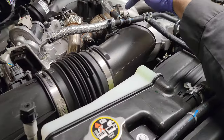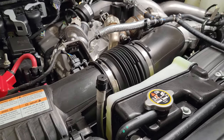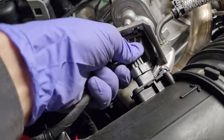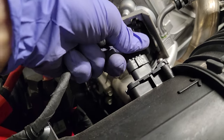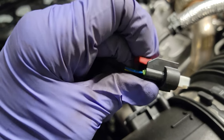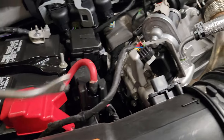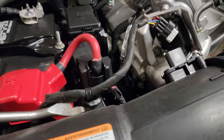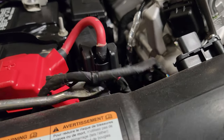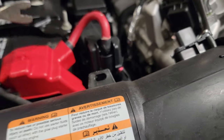We have a 7mm clamp up here and a 7mm clamp here — get this tube out of the way. We have a mass airflow sensor connector right here, and it's got a little slide tab that needs to be slid up. Slide that red thing and then squeeze the button and it'll come off. You'll also need a trim tool because you're going to need to remove this trim clip from the air filter — like that, get that pulled out.